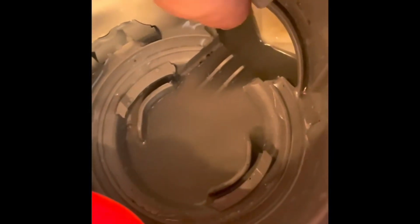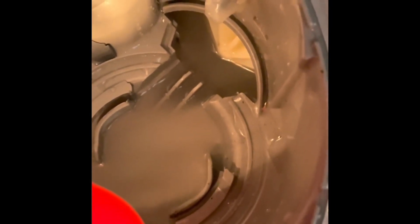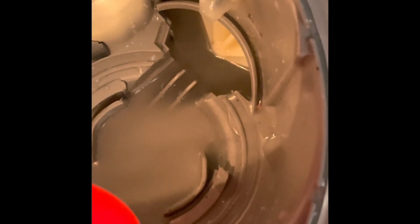Okay, the white lid is removed and you can see the impeller down there. This is a bit tricky. I'm trying to show you how to move this thing to make sure it's not stuck. I'm spinning it around and it's not stuck in any way. Usually what happens if there's a piece of glass or something that passes through these things into the impeller, it can block it, and if it doesn't spin, you will have the E-24 error. But I've done this a couple of times and the impeller is not stuck in any way. I still keep on getting the problem.